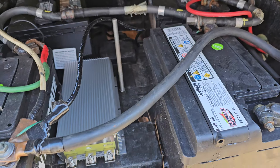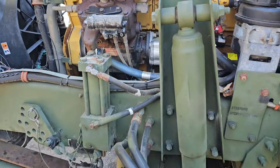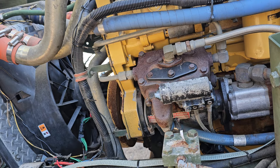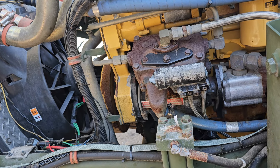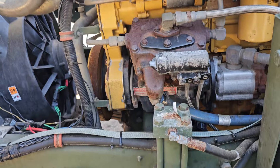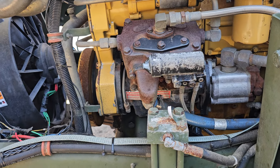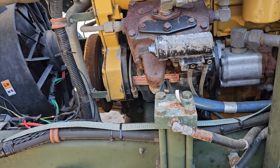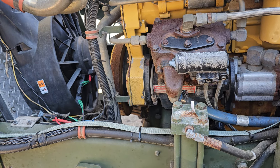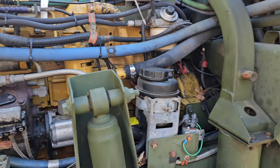The interesting thing about this build is the truck is split voltage. The 24 volts is only used for the starter and maybe a couple other small things — most of the load is 12 volts. The alternator is putting out 12 volts at 200 amps. I'm peeling off 50 amps to run the charger if it needs it, but most of the time — running headlights, running everything else — it's coming right off that alternator. The 24 volts is just charging up those batteries to start it. You could do it the other way with a 24-volt alternator stepped down, but that really doesn't make a lot of sense. That's it — it does work. Happy trails.